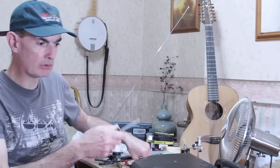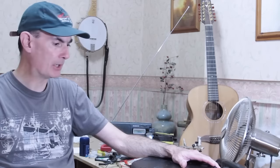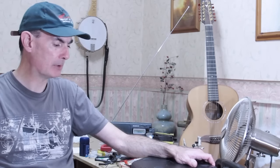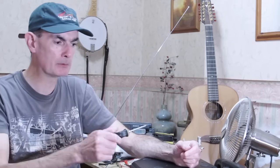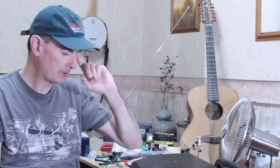And when it's together, the screws that they use, cheap though they are, hold it together quite adequately. So really, we're asking for trouble by taking it apart. But nevertheless, we are taking it apart. You've got to be very careful with these screws, because you can mangle the head very easily, and if you mangle the head, you won't be able to get it back in or get it out. You'll have to source replacement screws. So just something to be aware of.